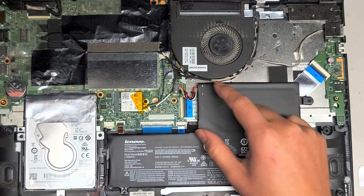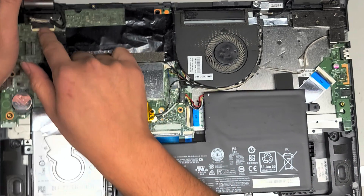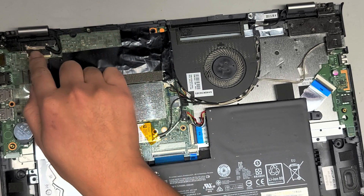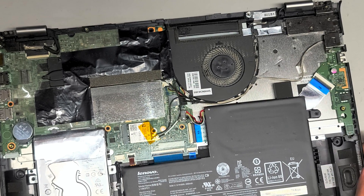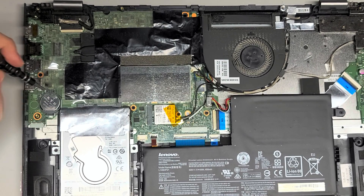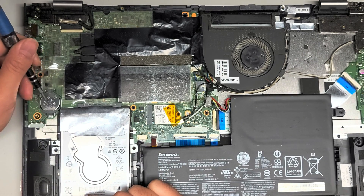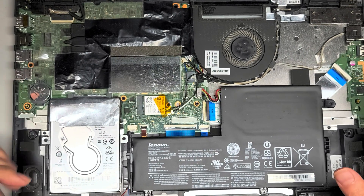I'm not going to go over what's underneath here — it looks like there's some stuff going under, but I'd have to peel all this up. The LCD LVDS connector is here, which also just flips up. You don't want to mess with this cable unless you unplug the battery and hold the power button for 10 to 15 seconds. If you're not sure how to remove any of this stuff, make sure to watch my other videos — it's basically the same idea for almost every computer. The CMOS battery is right here; it's spring-loaded — you just push the battery inwards and then you can pop it up.